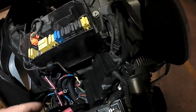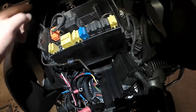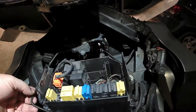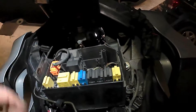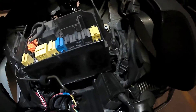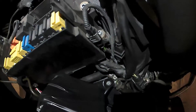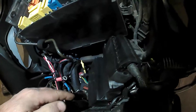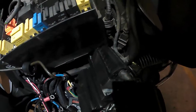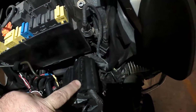Here is the place where the ABS unit was before. I took out all the lines except this one, which goes to the front connector. I do not need to take this out because it doesn't bother me, and it stays right where it stays. The other lines can be put back at any time. What I kept here is only the computer part from the ABS, and you can see that I isolated it with some tape in order not to let dust or anything else inside. This is the only one that is connected here through the ABS connector.